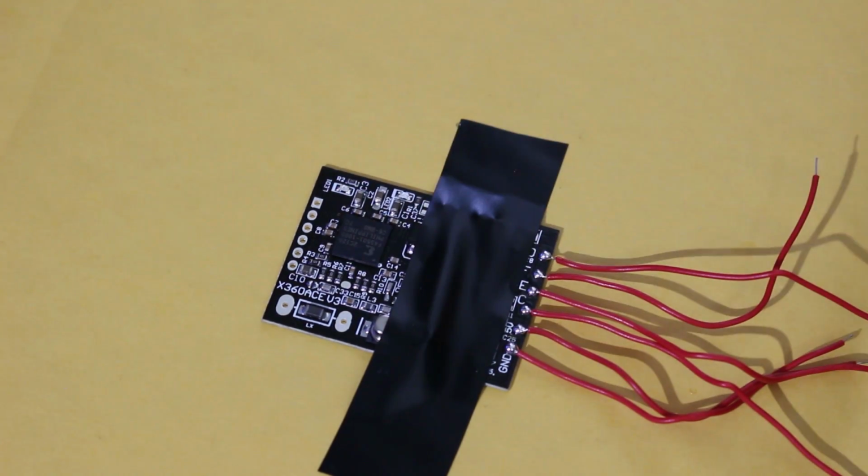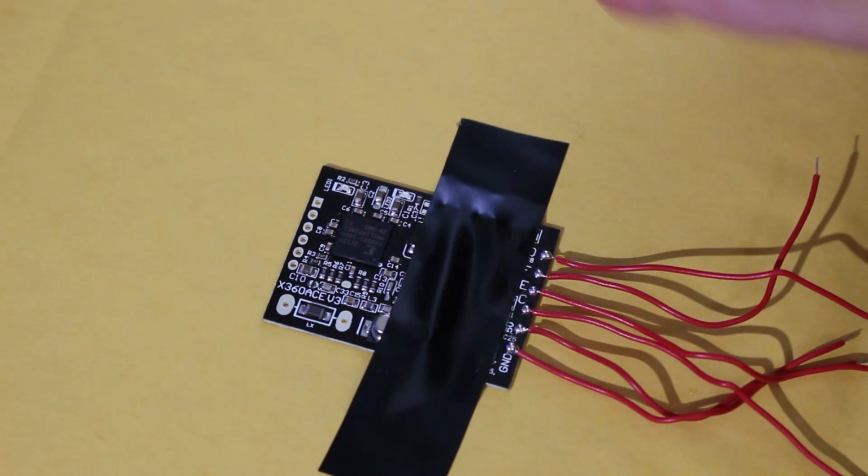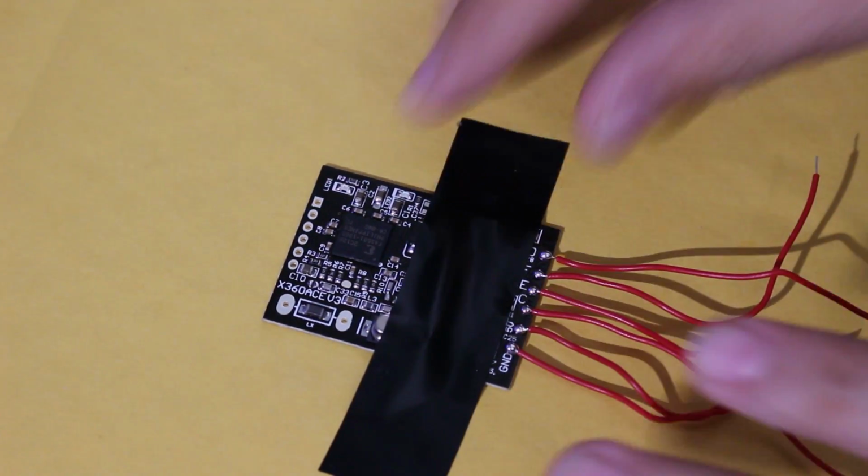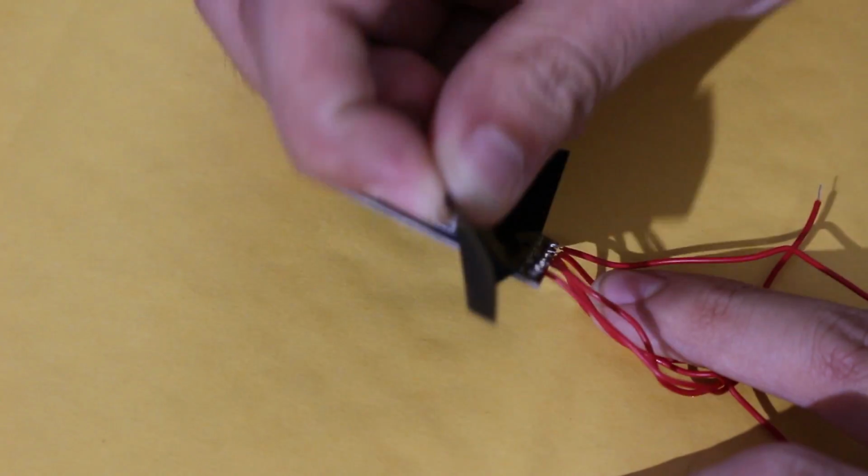So now that you have all the wires soldered in, if you're just doing a single NAND RGH install, you should be fine. However, we're going to be doing a Viper Dual NAND install, so if you're doing the Viper portion of this, continue watching, but you can skip ahead if you're just doing a regular RGH single NAND install. The reason I'm saying this right now is because there are also a few more points that we need to hit to prepare the chip.